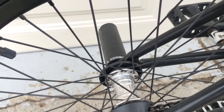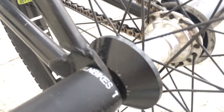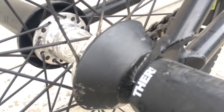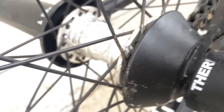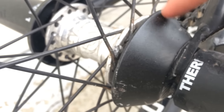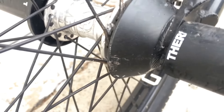If you can't run four pegs with your Profile Mini and you're wondering why your wheel keeps slipping — it's because you can't run two Profile hub guards. See how this one has little lines that grip your frame? This is a Primo hub guard, and Profile ones don't have those grips, so they slip on your frame. I had to dremel out the inside to get my chain to run through it.